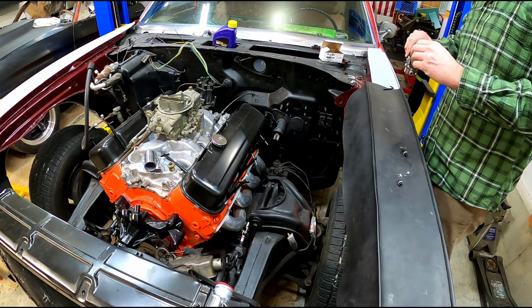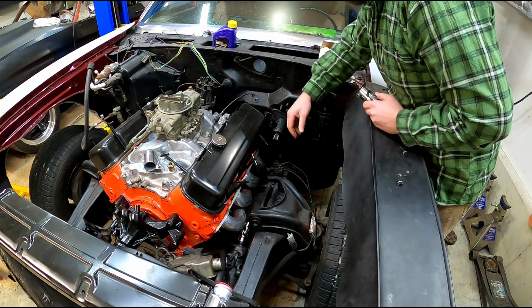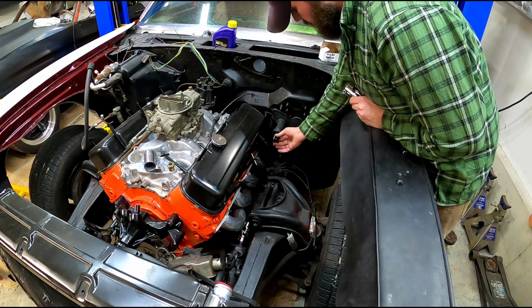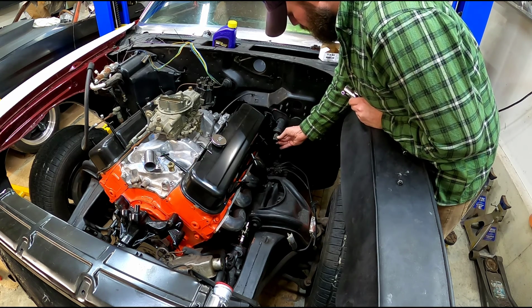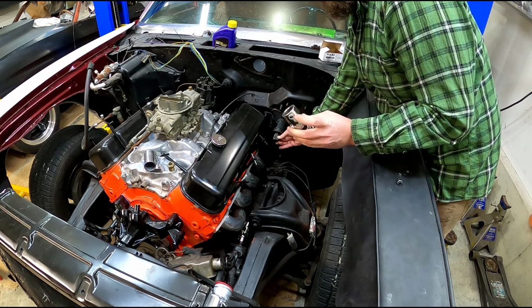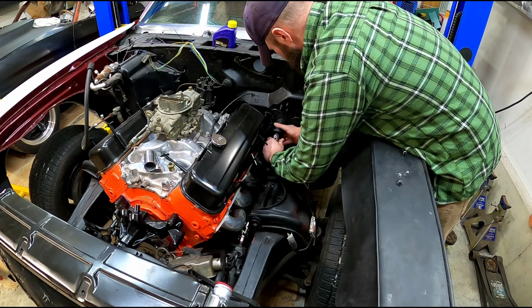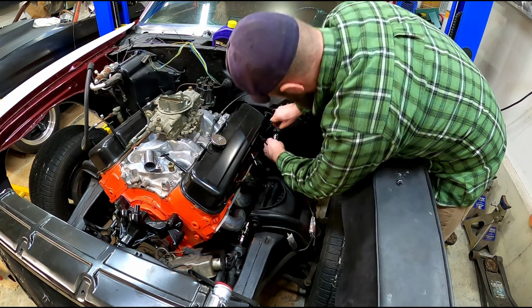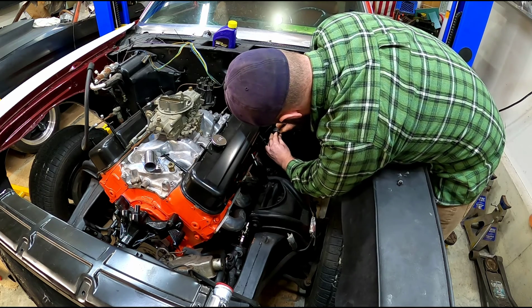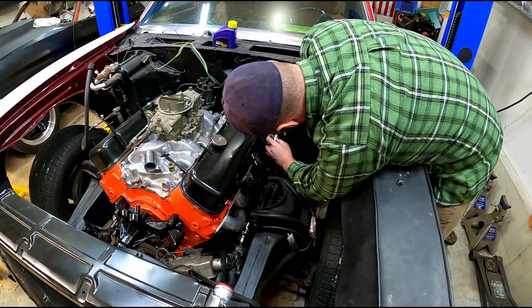And then this 1 inch will work nicely on the steering column. There's a flat spot on this one as well where it's grooved and recessed. We're going to mate that up with this locking provision right here. And we'll go ahead and tighten it down just for now, so it doesn't slide on us.